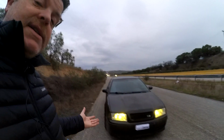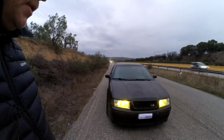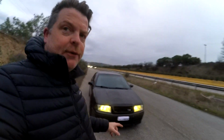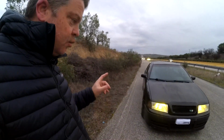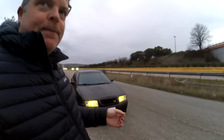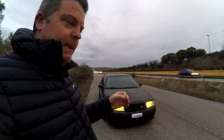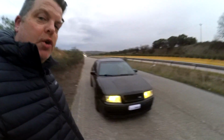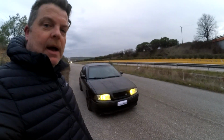So I'm not going to do anything that's going to compromise the light performance. So, yeah, those are the four methods I tried to remove a headlight film, and I think definitely the best one to do is, like I said, the sander. Should it have been so difficult to remove this headlight film? I think the answer is no. And I think the reason this was so difficult to remove, not being able to peel it off, and if you could peel it off, it was coming off in a billion pieces, is simply because it had been left on there too long. I would say renew it every 2 years, and I think you're probably going to be good to go. It's not going to be a disaster.